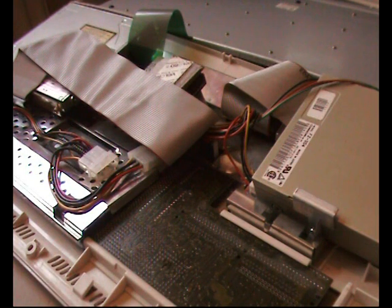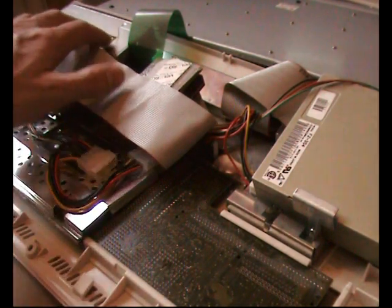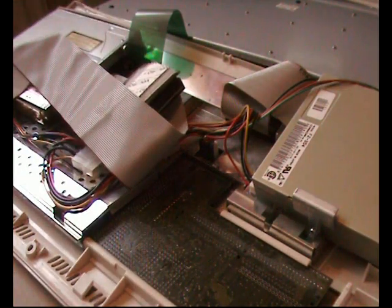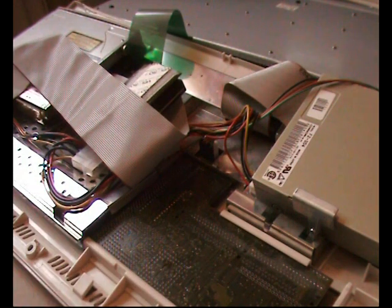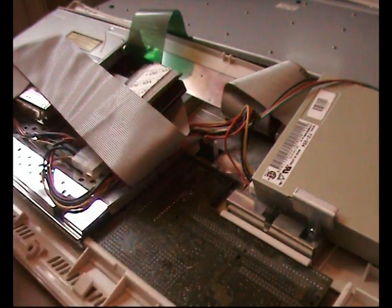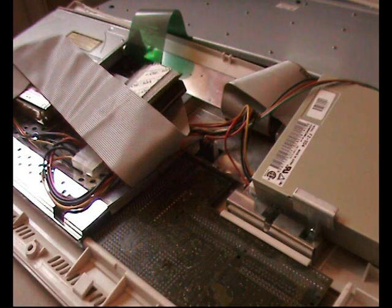Now this is really important. If you've got other stuff attached to your Amiga — for example an accelerator card, CD-ROM drive, and a 4-way IDE buffer — make sure you've got all of this attached before you partition the drive. If you attach the hard drive, partition it, and then add all this stuff later, your Amiga is just going to keep crashing. You need to partition your drive with all this stuff already attached. If you plan on adding any of this stuff later, chances are you're going to need to partition or format your drive again.